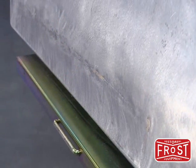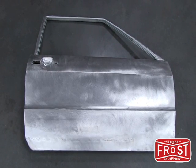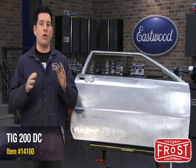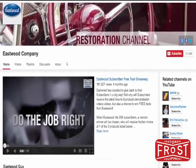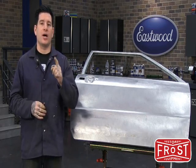This method of rust repair can be slower than using a MIG welder, but it's much more controlled and requires very little grinding in the end. I did use a couple small dabs of silicon bronze filler rod to fill some imperfections from cutting and re-fitting the panel, but otherwise all I used was the mini torch with the TIG 200 DC and .030 filler wire to complete this repair. For more videos on welding and fabrication, be sure to subscribe to the Eastwood channel and visit eastwood.com to get everything you need to do the job right.